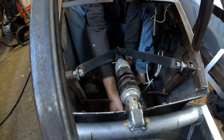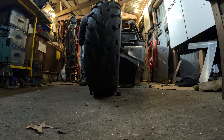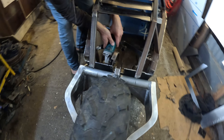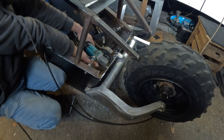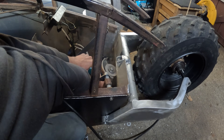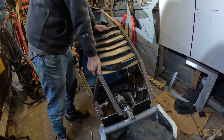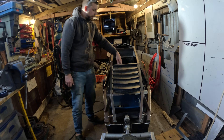I can just turn this and it will jack the front up — it's gonna take a while but I should be able to jack it up like this. The shock is pushing on there; I need to cut that slot deeper but it's starting to balance now. The spring feels good, but there's just no rebound at all in that shock — I'm gonna have to try and fix that. At the moment I'm just winding it up and down with the ratchet.